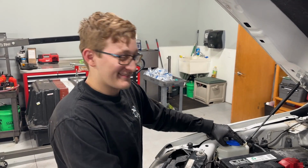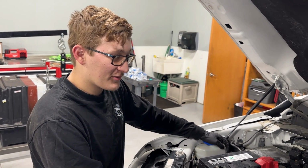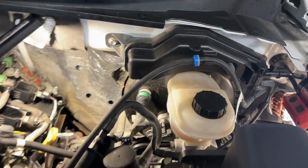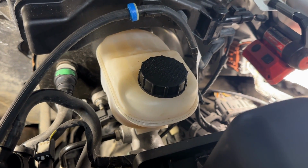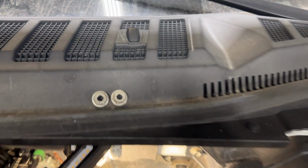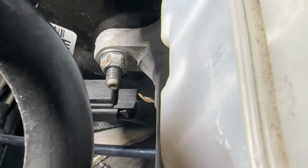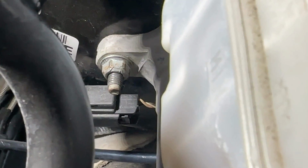We figured out the extra nuts, didn't we? Yeah, well, I did. I'm getting old, I guess. One of the first things I did was put the master on, and couldn't find the nuts for it. These didn't seem to thread on there. They look like they're way too small. So I grabbed some Ford flange nuts from my Ford bin, perfect size, M8 by 1.25, no problem. And I put it on.